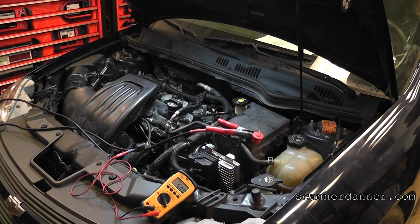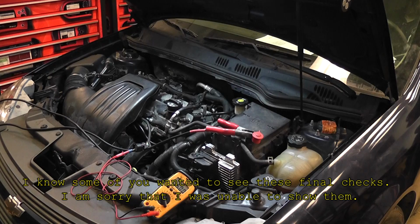What I told the engine teacher is to button everything back up, put the wheels back on it, everything underneath it, so I could get it into my classroom and finish. Okay, so now this is where we are. Unfortunately, they sent it to the dealer to get the computer replaced without my final checks. Now, what this is showing me though is it was the right call. We did have a faulty engine computer, and you guys will benefit from watching the part 1 at this point to where we are. This reference voltage was missing.